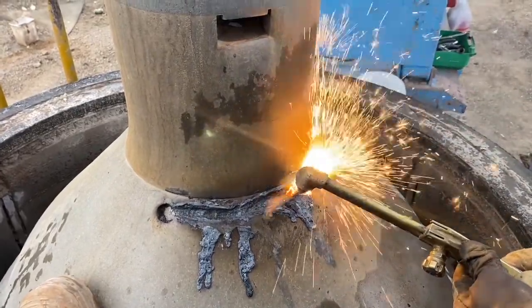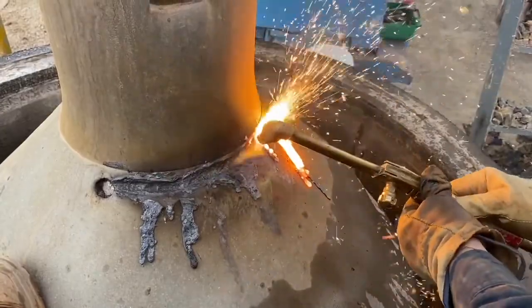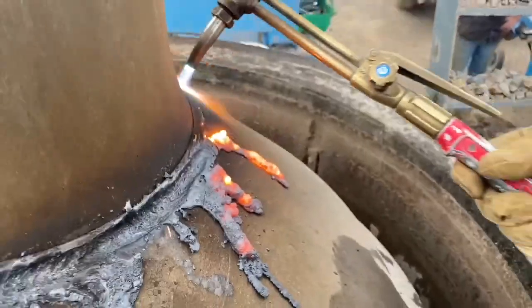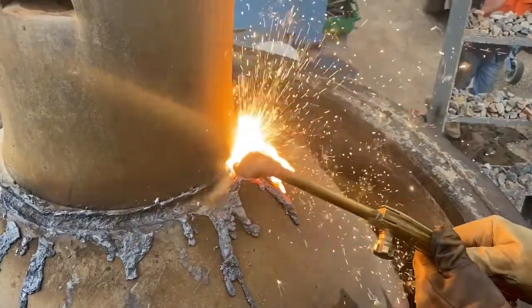The centre of your cut should be about 20mm away from the mantel nut. You need to do the cut in one smooth action and it shouldn't take any longer than five minutes to get around this one. If you take too long you'll heat the mantel and the nut up and it will work against what you're trying to do.